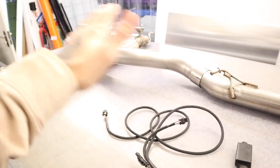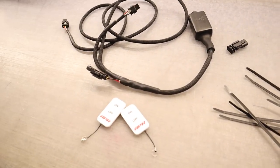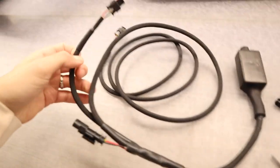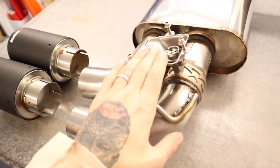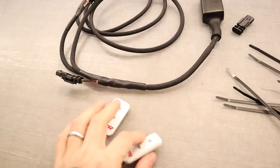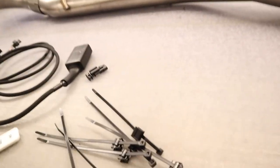What's going on guys, Alex here and welcome back to the channel. Today we're doing a quick install video. I've got some more goodies for the Golf — the APR exhaust flap remote override system. It's literally just this little harness that connects into the factory valves. It comes with two remotes: on is valves open, off is valves closed, back to original factory settings. Comfort mode is valves closed, and race mode the valves open.